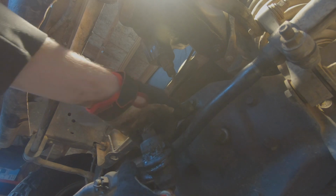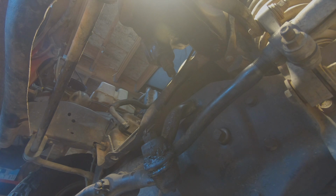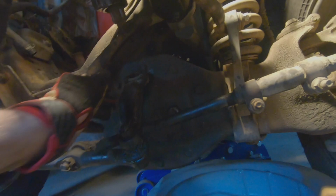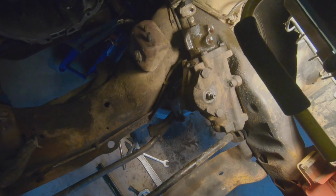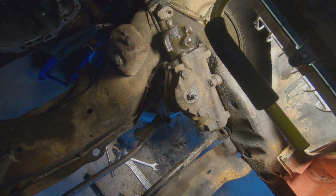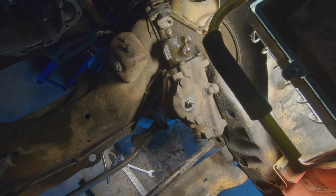And then I started hitting it with the hammer, and the hammer really was working. So that's good, the impact. So we're just gonna leave our arm right there. And I made a mark to help us align it when we're done. But I don't think that will really help us because we're replacing the box, and that's our alignment tool. So our box is ready to be pulled now. Steering box, and we'll put the new one in.